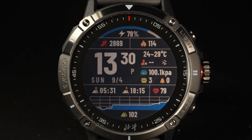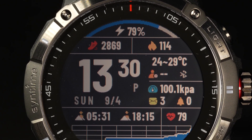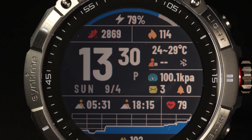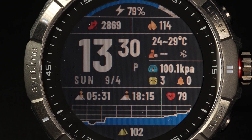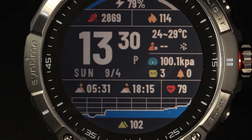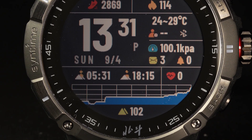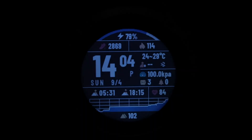At the front, you have a memory-in-pixel display protected by hard sapphire crystal. The MIP display works similarly to segmented LCD displays in that it works primarily by reflecting ambient light. This means you won't get readability issues in very bright conditions, unlike OLED watches. And because it's not using a power-intensive backlight, the power consumption is really low. This allows the Beidou to keep its display powered on all the time, giving it an advantage over most other smartwatches that turn the display off to conserve power. When it gets too dark, you can also turn on the backlight.